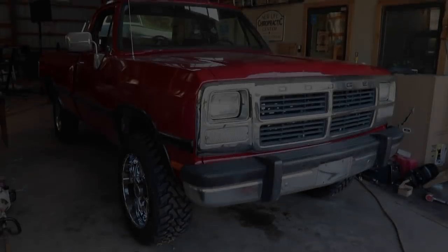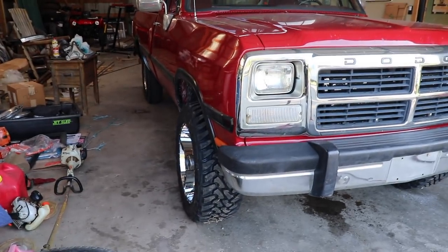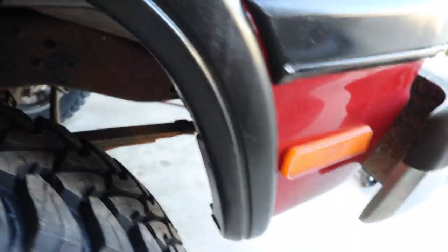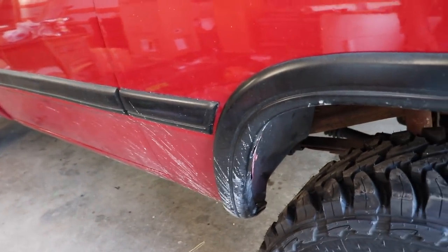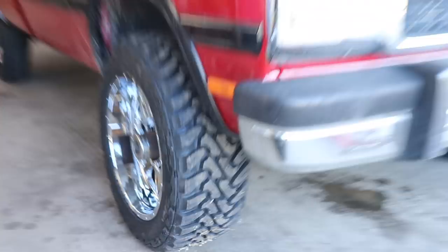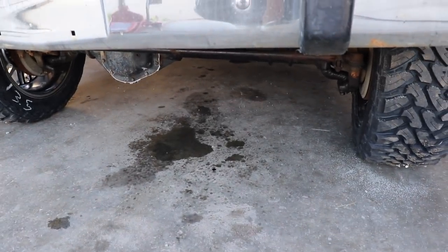The wheels do look really good, but due to my leaf springs being extremely flat — in fact kind of reversed in the front — I'm going to need the leveling kit installed before they'll perfectly fit. It almost clears but just rubs a little bit. If the tire went back it would snag, and on a full crank these knobby tires would rip the fender off. I don't want any problems with that. But you can see there's a big difference in appearance from the front — just a beautiful setup on this truck.